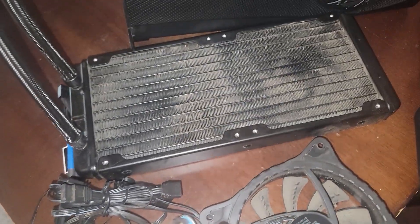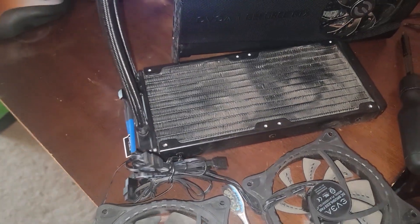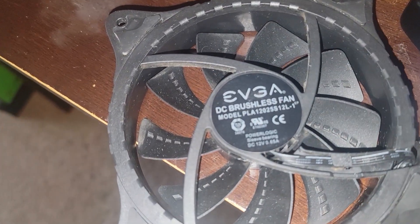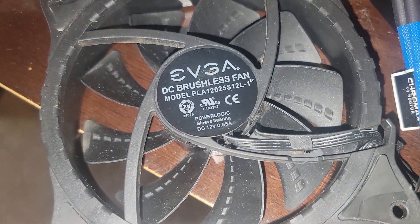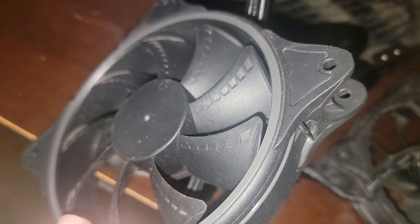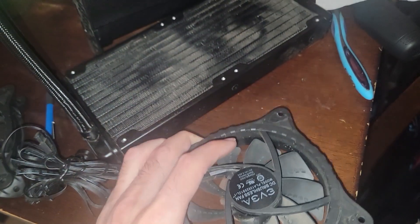You can clean these up to almost new — you can still see where the dirt was behind the fans, but get it as close as possible to restore that airflow. These two blades I have not cleaned; here it is cleaned with the soft bristle brush; and here it is completely clean with a little bit of Pledge. Use a soft bristle brush to loosen up the dirt and then a paper towel to clean the blades — it just brings renewed life and airflow to your system. Don't be shy, clean your fans.